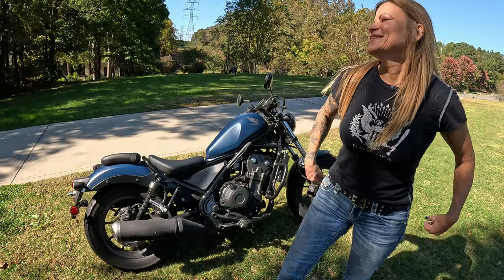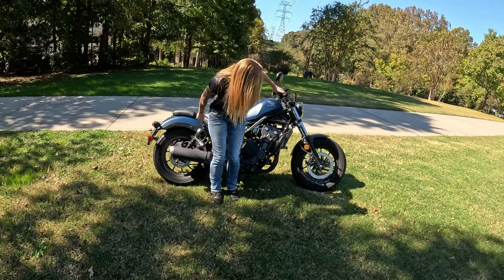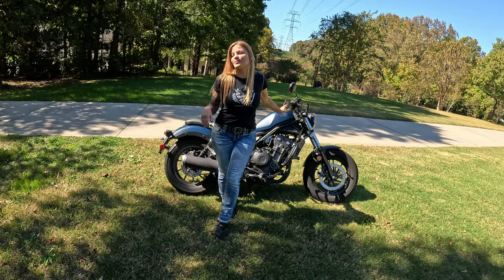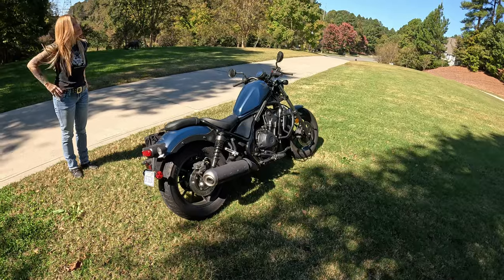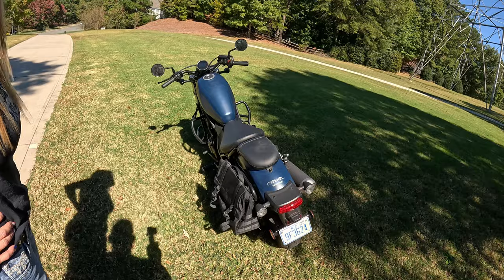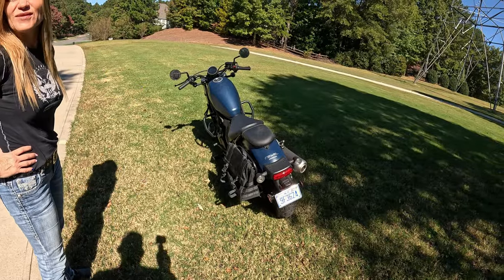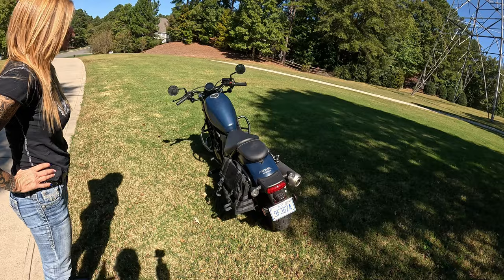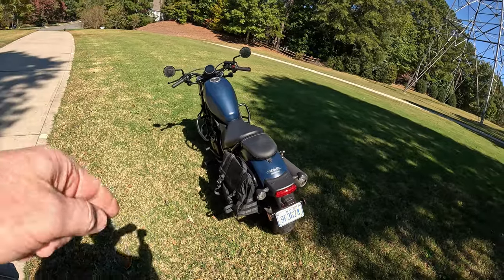It does feel different when you're doing it that way. And if the bike had started rolling, to my point, you just grab the brake as you are standing the bike up — then it wouldn't roll either way. It's the exact same concept if it's down on the clutch side of the bike. The difference is, when you're pushing it up with your butt, at a certain point you have to realize it's high enough that you've got to put the kickstand down — kind of when you get it level, just pop the kickstand down. The bike leans further than you think when you put it on the kickstand, but that means you can get it up to the balance point and put the kickstand down.